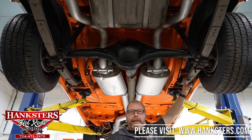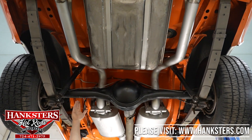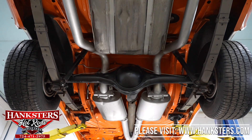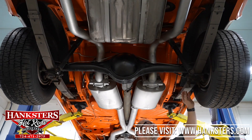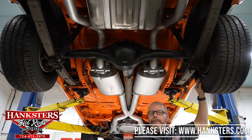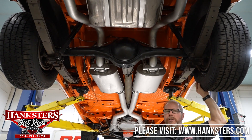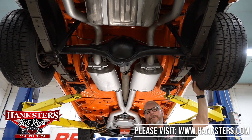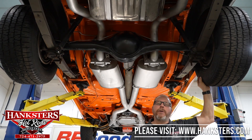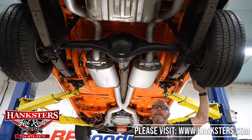As far as the rear suspension, we've got your multi-leaf rear suspension here with a nice gas shock. All of your bushings, mounting hardware, and everything looks really good back here. All of your brake lines are leak-free and plumbed all the way back — no leaks. These are drum brakes on the rear of the car. Just to remind you on the wheel and tire combination — we do have those Scott Drake Legendary Magnum 500 style wheels: 15-sevens up front, 15-eights on the back. And the BF Goodrich Radial TA tires — 225/60/15s on the front and 245/60/15s on the rear — all matching tread. BF Goodrich tires are great tires and very popular on these old classic cars.